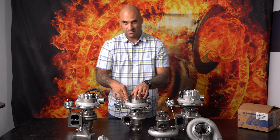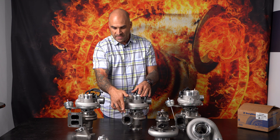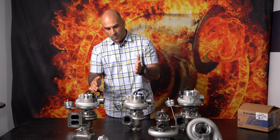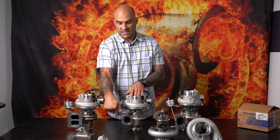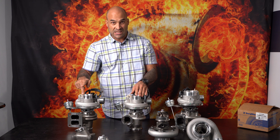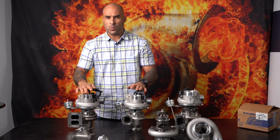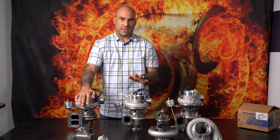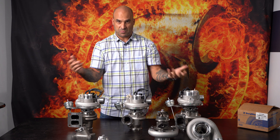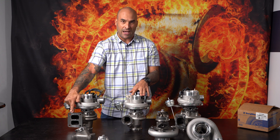On the V-band housing, it is also representing the T25/T28 family in terms of turbine housing size, but the AR is 0.85. That is the main reason there will be a boost response difference between the V-band and T25 inlet. They both share the T25 family — the AR85 turbine housing and the AR80 smaller housing on the twin scroll inlet.